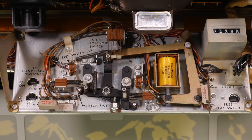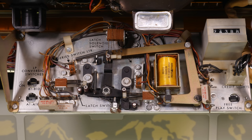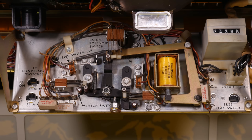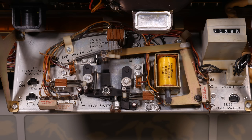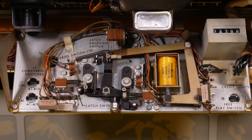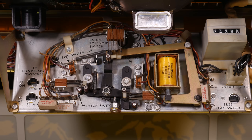Ultimately, these two brackets simply redirect the motion of the solenoid's travel from up and down to left and right, and relocate where it applies its pulling force. I honestly can't fathom why it was designed like this, as there looks to be room for the solenoid to simply pull directly on the linkage, but it is what it is. To the left of the solenoid is where the action actually occurs. Three vertical linkages are arranged one after the other and are connected at the bottom to a horizontal piece. Overall, this has a sort of trident shape.